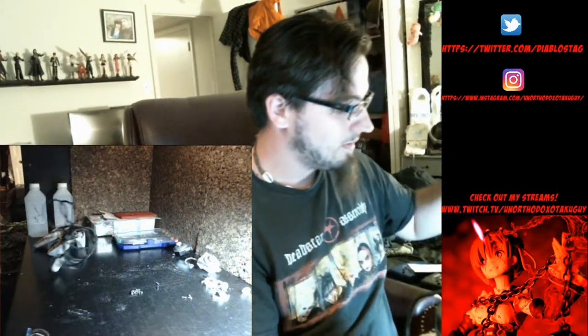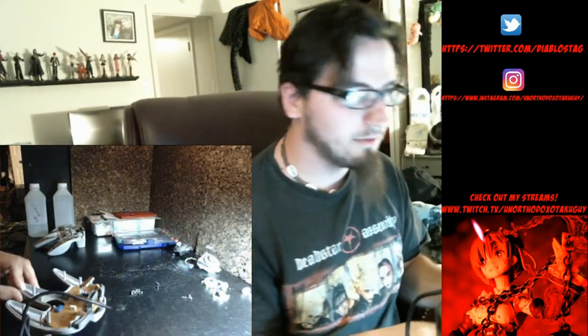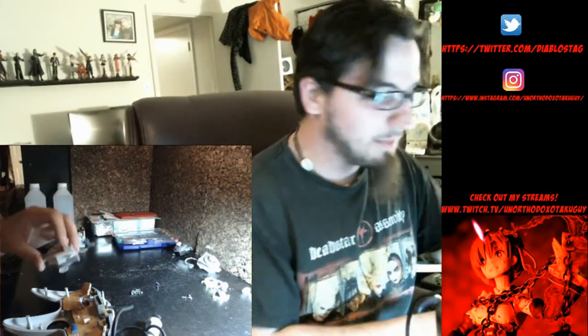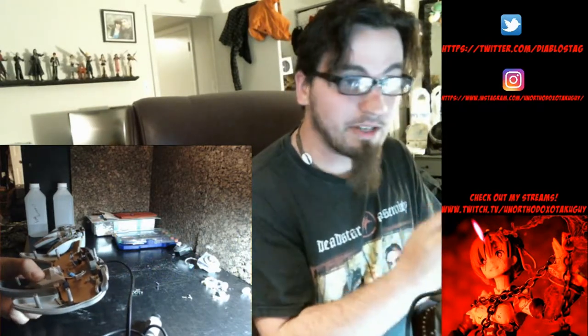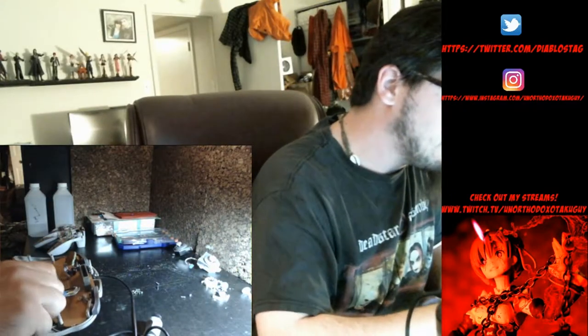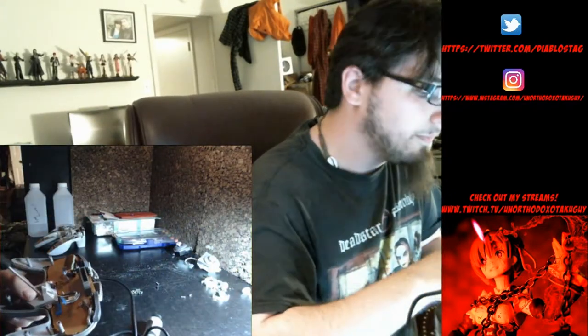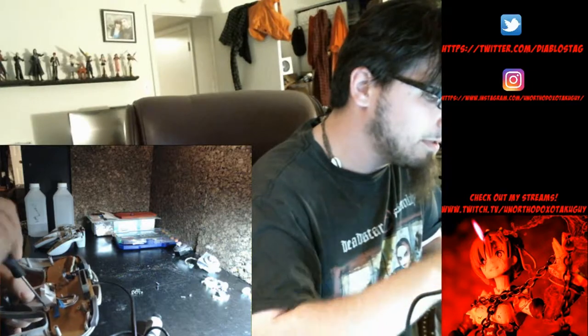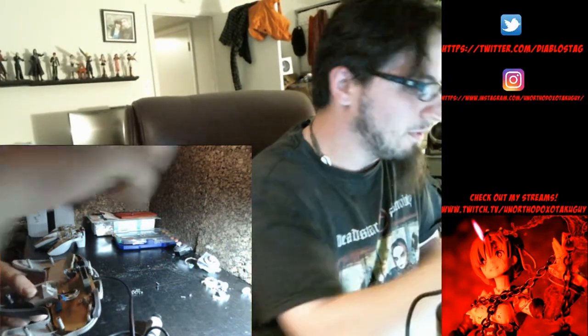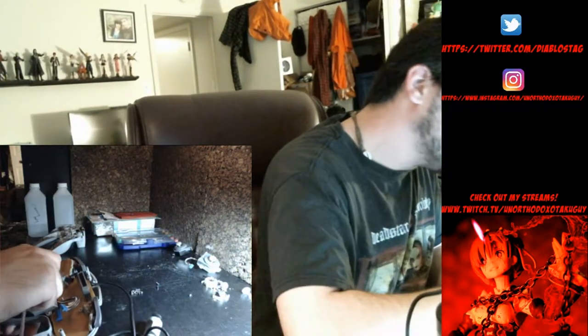So, now that we have Nintendo cocaine all over my desk, as you can still see, I'm going to clean it up after I'm done. We're going to take the mechanical control stick that's been rebuilt and drop it into the spot. Do the three screws first before you plug it in. So get those three little ones, they're probably silver, and screw those into the controller. Don't over torque them. Just get them so they're snug.